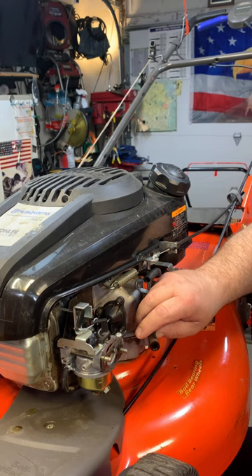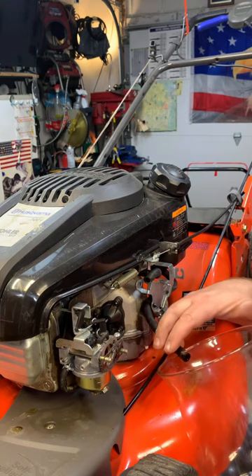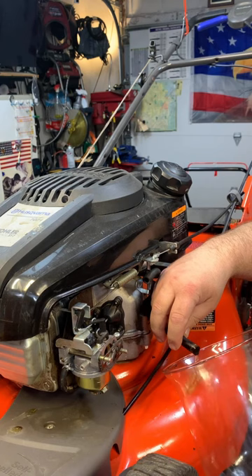The tank is full, the tank's not stopped up with anything. But if you open this gas cap, that fuel starts flowing just fine. What you've got here is a bad gas cap that's not vented, and when you close that cap off, your fuel stops flowing.